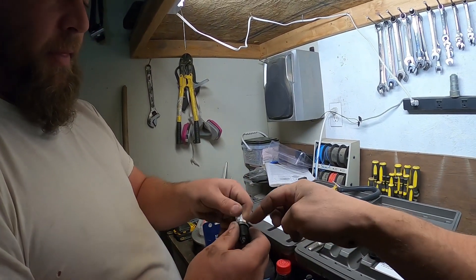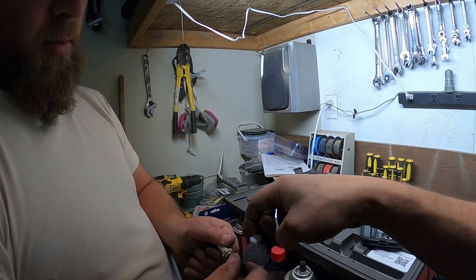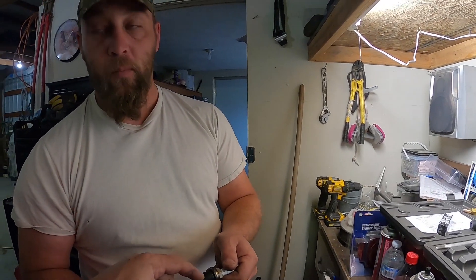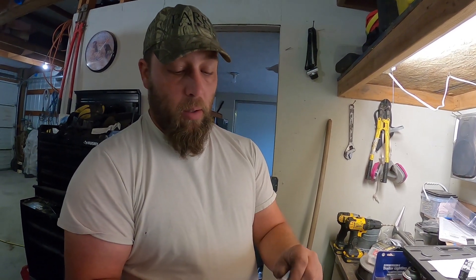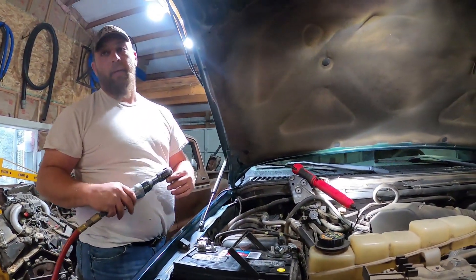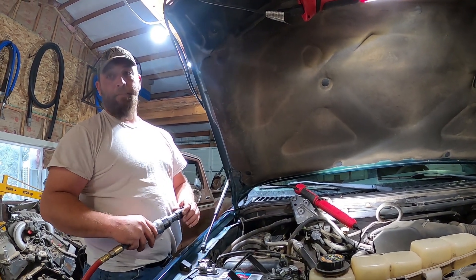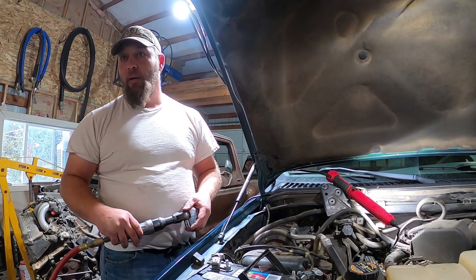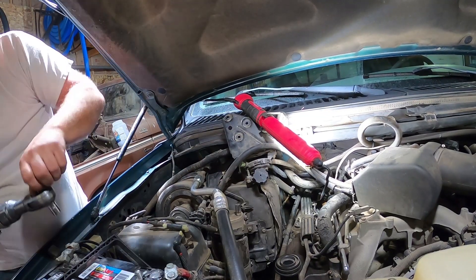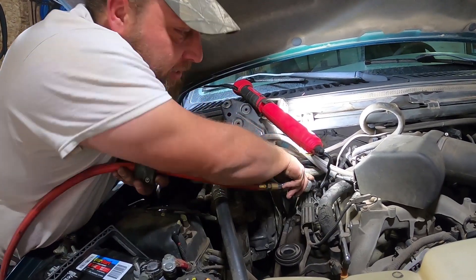So we're boring it out — these are the new threads. It's the same concept as the cheaper kit, but the cheaper kit doesn't use a factory plug. This one has cutters in it and cuts its own way. The cheap kit — yeah, this one will be threaded in forever. It's an actual helicoil. I've never done a helicoil before. People are gonna be like, 'Oh I need to put JB weld on it' — but why wouldn't we just use Loctite? Because JB weld is gonna hold it — I don't know, I'm new. Helps to go the right way, I guess.